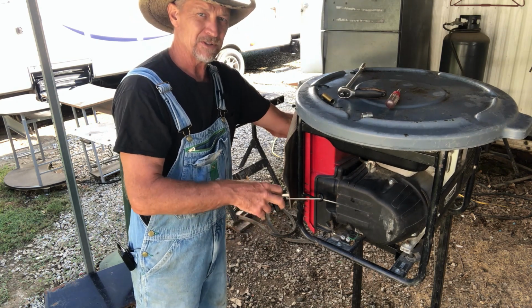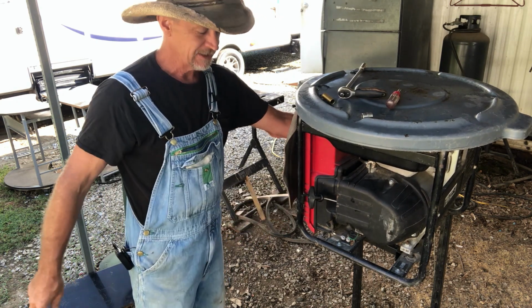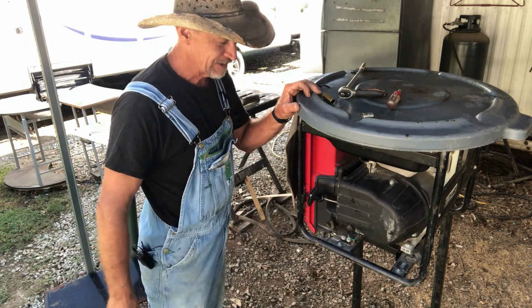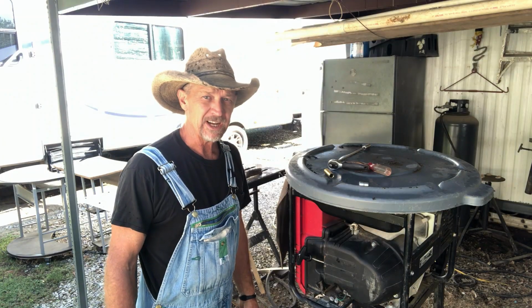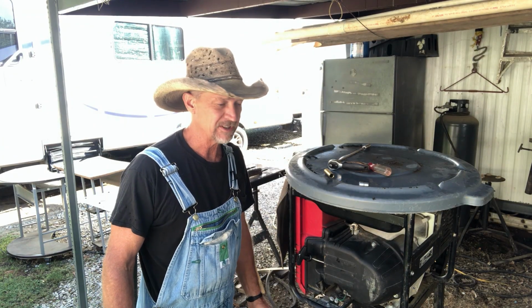And guys, most young people don't know that if they ain't never been taught that. They'll just walk up there, they're young, they're stout, grab that cord and whap. And when they do it, it may not break it the first time, but a few times doing that, they're gonna break them ears off. But guys, that's it for how to replace a crank rope in a manual crank engine.